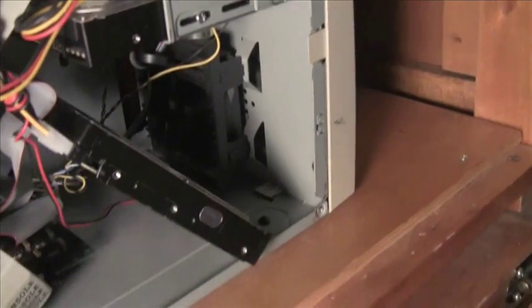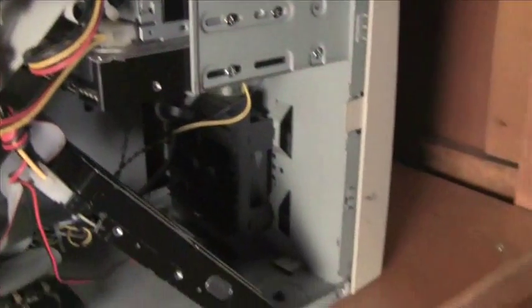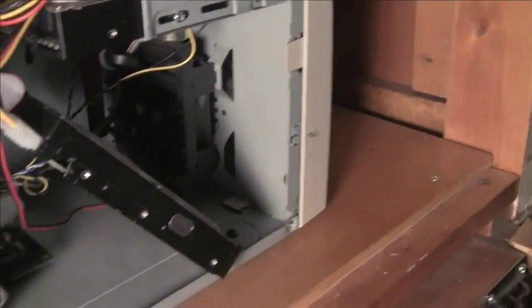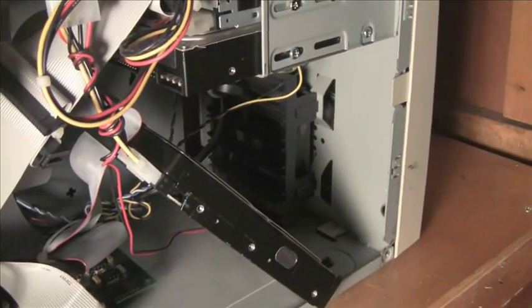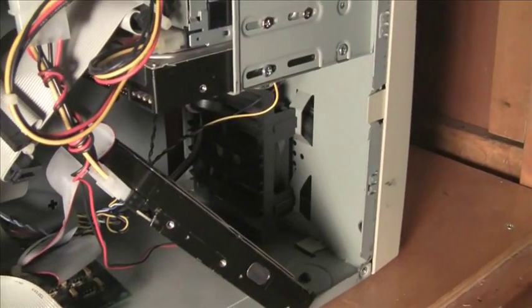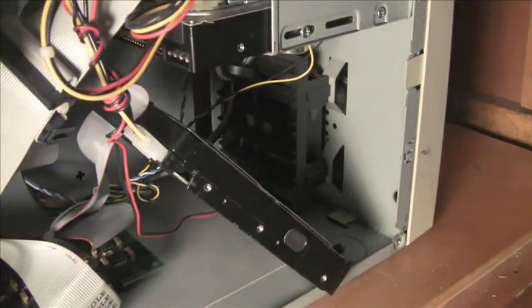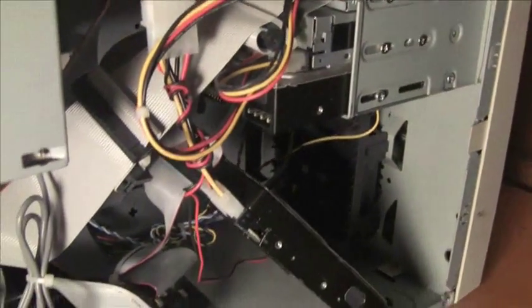I have that hard drive — that's a cloned drive. The original drive that's running on Windows 98 is still mounted up in the computer, but I have a cloned drive, and that's the drive I'm going to upgrade. Because if anything goes wrong, and many things can go wrong with an operation like this, I'll be able to switch back to the original drive, and we'll clone up another spare drive.